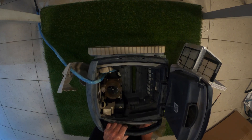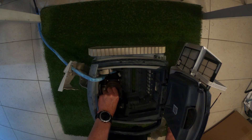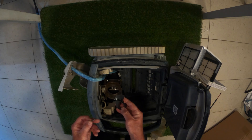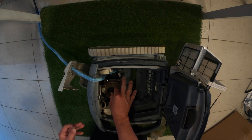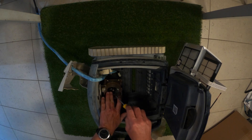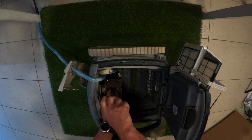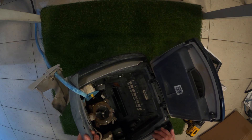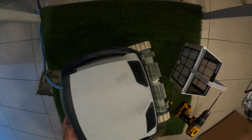We could also unscrew the impeller pretty simply, and that's an important thing. On a good quality robot, you should be able to access all of the main parts that wear or sometimes get entanglement. It's nice and clear. Be careful — the edges of the impeller are quite sharp. You also want to check that the rapid drain flap is in place, so that it's not curled up and getting caught on the roller or the brush.